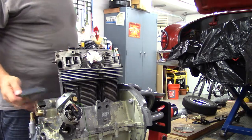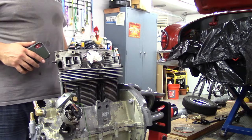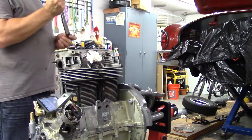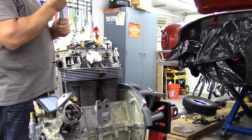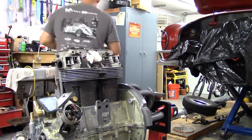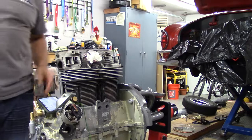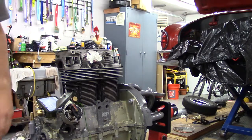She's done. Now I've got to get the rockers back on. I'm going to set the valves back to lash zero — I won't bore you with that. Hoping the 20-thousandths didn't mess up rocker geometry — that's a whole fun task if you haven't done that one yet. You spend a lot of time trying to get it to look right. There are tips, tools, and tricks; you've got to hook up dial gauges, measure half-lift, and check with square angles to make sure you're lined up good. But that's probably a whole other video.